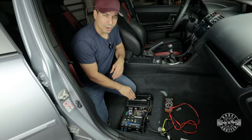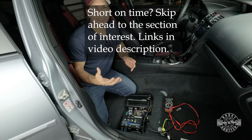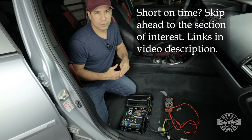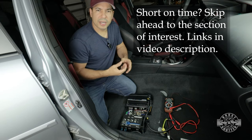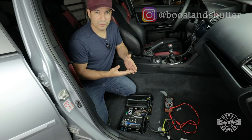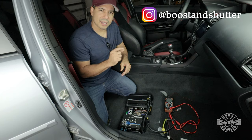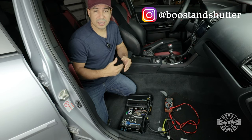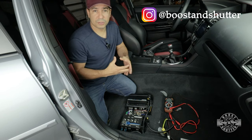Gain is your sensitivity adjustment for the amplifiers — it tells the amplifier how sensitive it needs to be for the signal it's getting. Let's pretend you set out one day to make your own head unit and amplifier. You build the head unit to put out a very specific voltage, and you have the luxury of knowing exactly what that voltage is. So when you engineer your amplifier you use that exact knowledge of that voltage to set the internal gain.